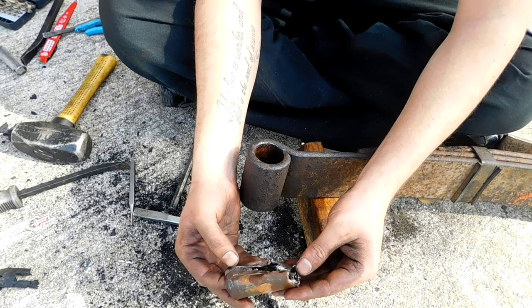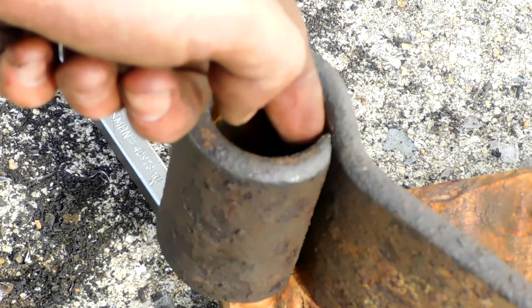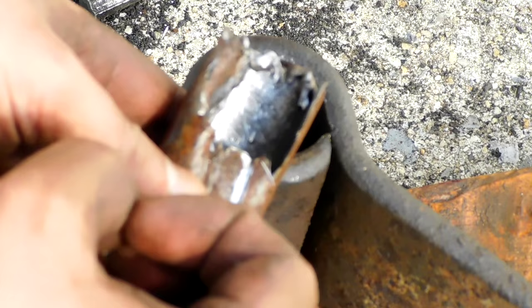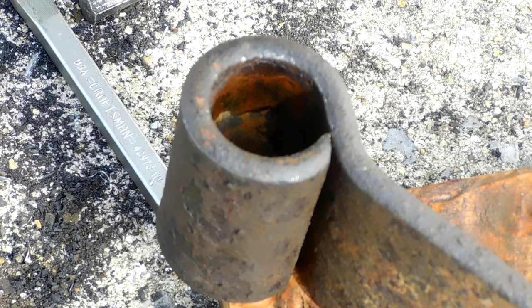You really need to beat on this. If you had an air hammer and an air compressor, you'd probably have it out in a couple of minutes tops. The trick — I'll give you a better angle here — is on the inside of this seam you've got to cut a groove in the sleeve. As you cut that groove, you're able to kind of implode it and squeeze it upon itself, making it smaller and smaller until it comes out. I've seen guys jam a chisel or a pry bar in there to make the eye slightly bigger, and therefore the sleeve becomes smaller — that is how you get the sleeve out of the leaf spring.